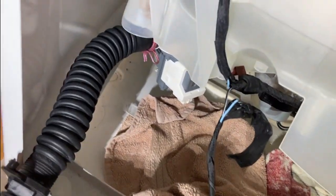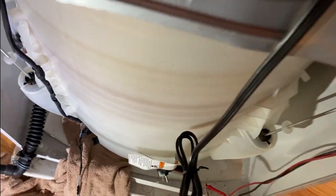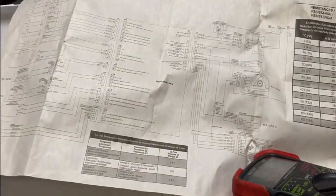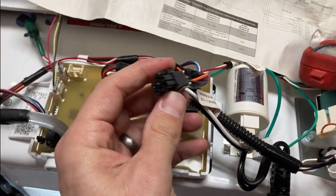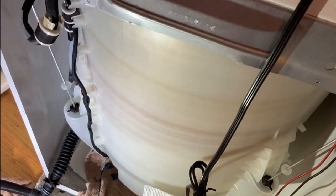I'm going to strip that wire. It took me a while to find it because I did a lot of testing on the pump to make sure the pump was still good. I messed around a lot looking online trying to find a good service manual — I couldn't find one. I have the normal manual that came with it and the wire diagram. The owner's manual doesn't have any details for diagnostics. Anyway, I'm going to unwrap this wire a little further and make sure I have continuity from here all the way up to this plug. If I do, I'll probably just splice it and put it back together. If not, there could be another break and I may just rerun the wire.